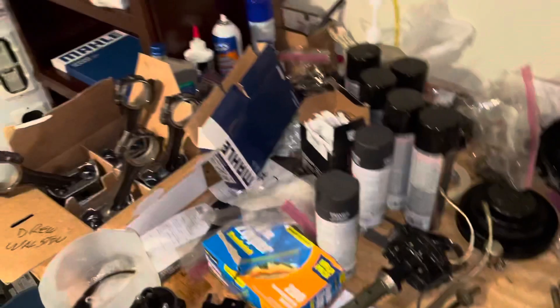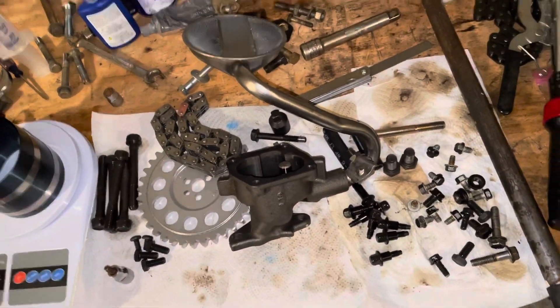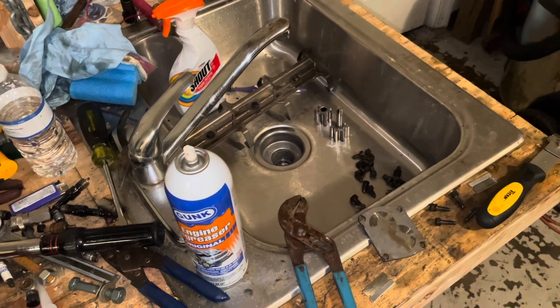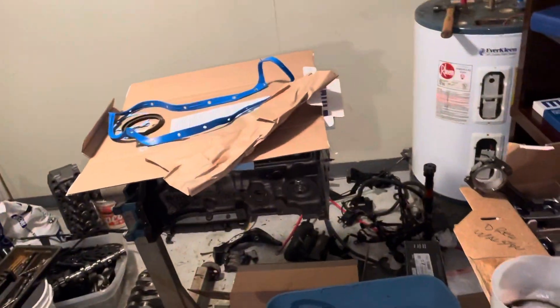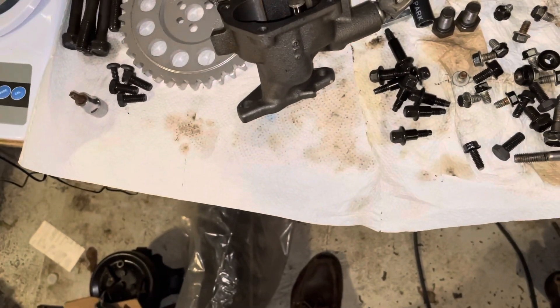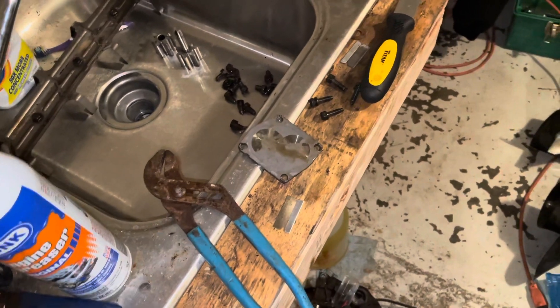I do have some Gunk for the hard stuff that won't come out with Shout. The reason I use Shout is my sink is tied to the septic system and I don't want to run Gunk wastewater into it — I'm not sure how bad it would kill the bacteria in there. At this time I'm fixing to reassemble the oil pump. I'll see if there's a replacement gasket in the set; if not, I'll reuse the original since I was careful not to destroy it. It's submerged in oil in the oil pan anyway, so I'll blow-dry the gears and clean the cover before putting it all back together.